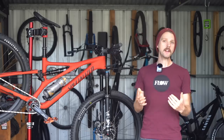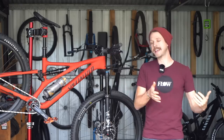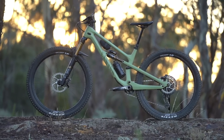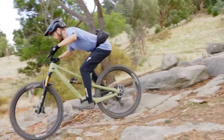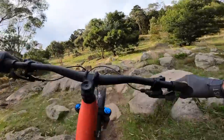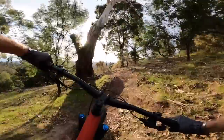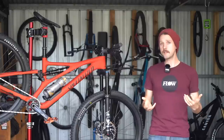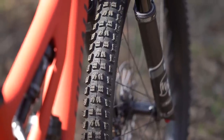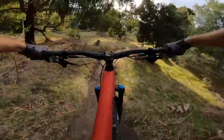The enthusiastic suspension performance is nicely complemented by the lightweight carbon chassis which offers fantastic compliance over rough terrain. Coming off the Canyon Spectral 125 — a simpler bike in terms of travel and geometry but with a more progressive suspension design and a much stiffer carbon frame — the Stumpjumper is a much more comfortable bike. The alloy rims and supple tyre casings contribute to the overall compliance. The 2.3 inch tyres are well suited to the Stumpjumper's intentions, offering a nice degree of damping without feeling floppy or cumbersome on tight single track. The Stumpjumper is noticeably slower rolling than last year's bike due to the aggressive Butcher on the front with the new GRIPTON T9 rubber compound — personally I think the increased rolling resistance is worth the trade-off, with that front tyre providing an outstanding level of grip in most conditions.